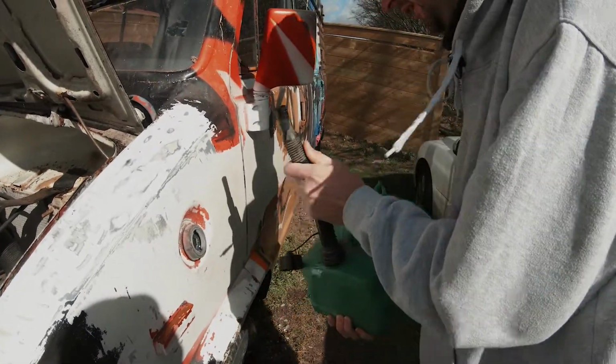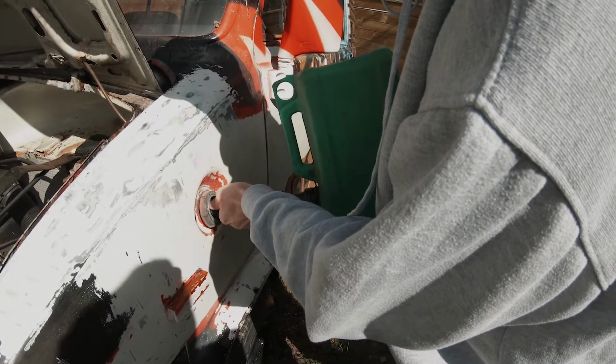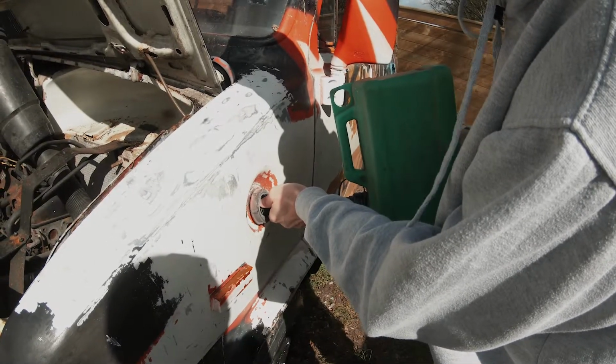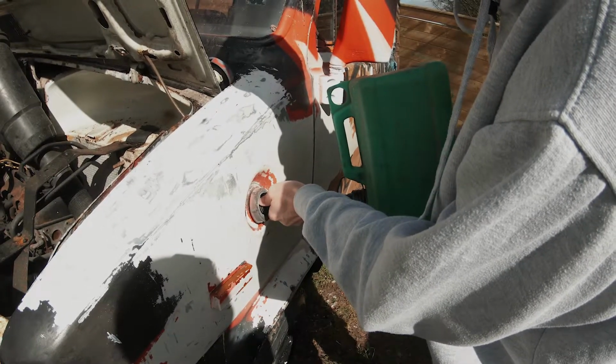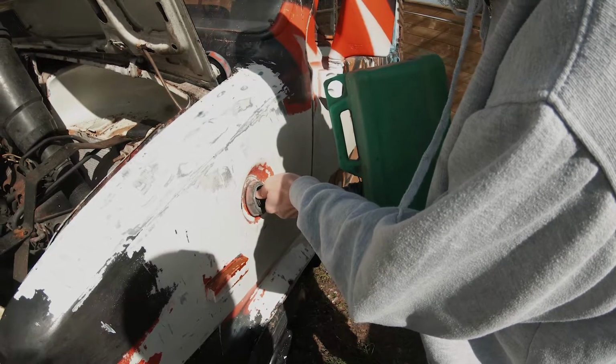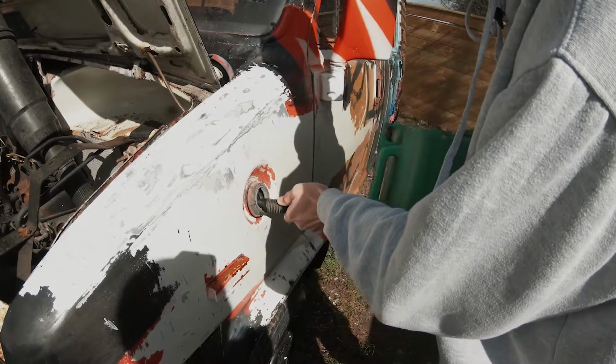As you can see, I did have a go at removing some of the spray paint from the passenger side front wing and door. I used a graffiti remover, but it was really toxic stuff, creating some nasty fumes. So I stopped using it and I decided I would just use wet and dry sandpaper and an orbital sander for the main bodywork going forward.